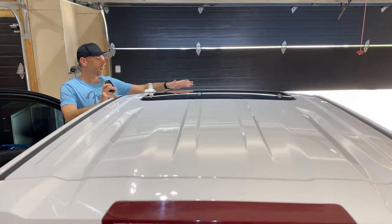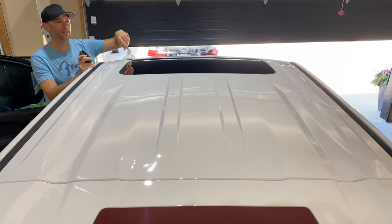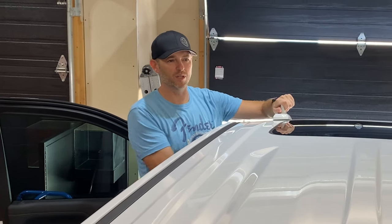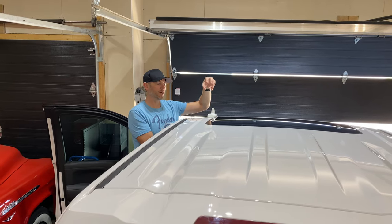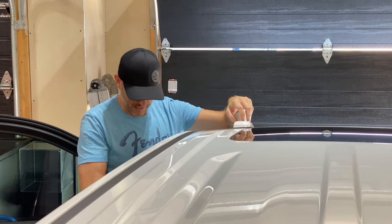It's not going to be too hard wrapping, but first let's do measurements. I need to do a small cutout ahead of time in the vinyl film so the shark fin will fit through it. To uninstall the shark fin I'd have to loosen the headliner, undo a bolt underneath, and pop it out — I really don't want to do that. So I'm going to cut around it, lay the vinyl in, and wrap the shark fin last.